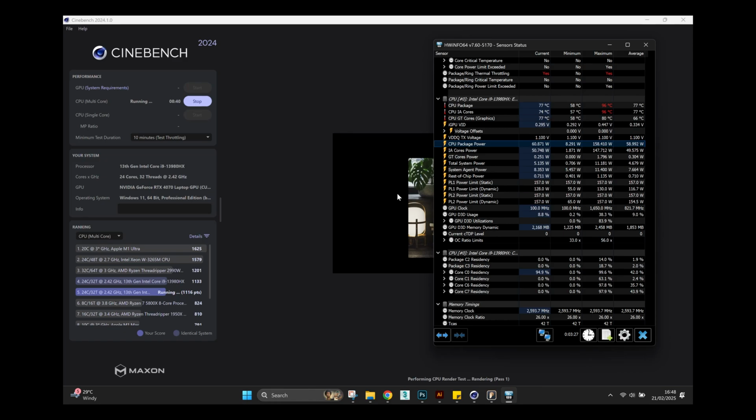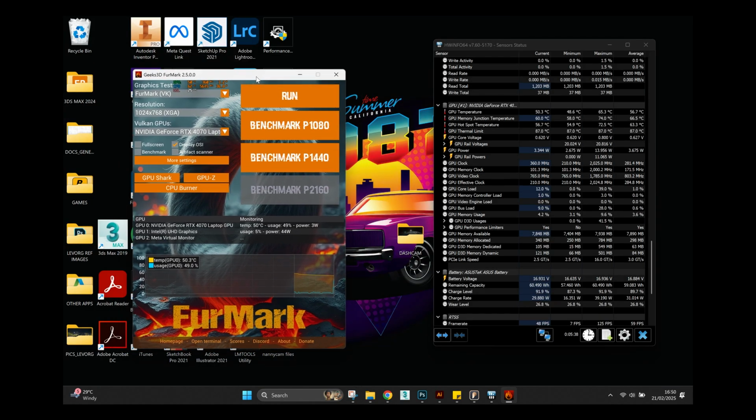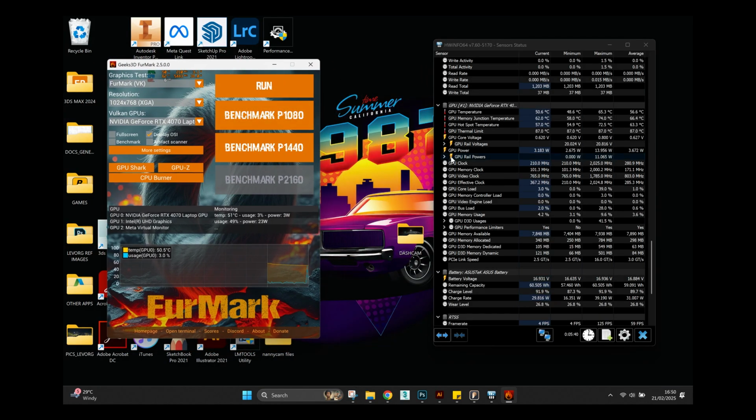Yeah, so here in this video, you can see the initial power target was hitting at around 160, 158 watts. However, after some time, the CPU starts throttling back heavily. How you can notice this is you'll see the power dropping between 140 watts, going all the way back down to 17 watts, and so on and so forth. So that means that there's likely an issue with the CPU's pasting.